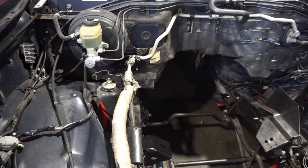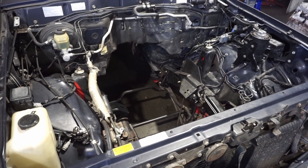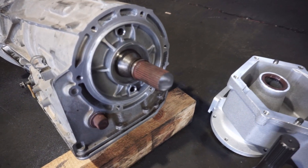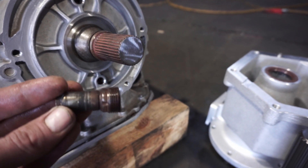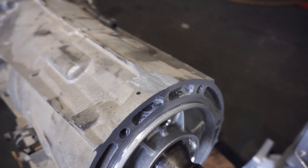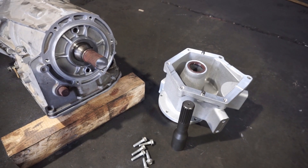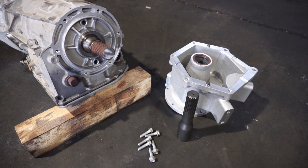We won't go over the engine mount brackets again, but we'll quickly go over the transfer case adapter kit for the 6L80. I've removed the extension housing off the 6L80, cut the threaded part off the back of the output shaft, and polished up the back of the shaft so there are no cut marks for it to crack. The top rib on the gearbox needs to be ground back for the adapter to fit. The O-ring is no longer required — just silicone seals the flange. Now we can bolt up the transfer case adapter.